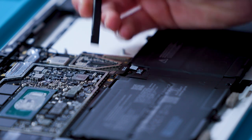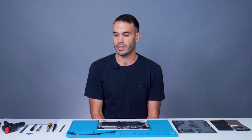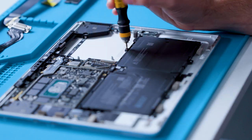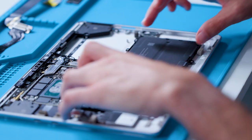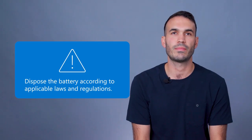The battery connector is now exposed and can be disconnected from the motherboard using a plastic spudger. Next, we'll remove the battery. We will ensure that it has been disconnected from the motherboard. Then remove 8 screws using a 4IP bit. Lastly, we'll remove one screw with a 3IP bit. Once the screws are removed, the battery can be removed from the device. Be careful to only handle the battery by the frame on the sides. Always protect the battery from accidental pokes, impact, and bends during the repair, and account for all screws upon completion of the repair.